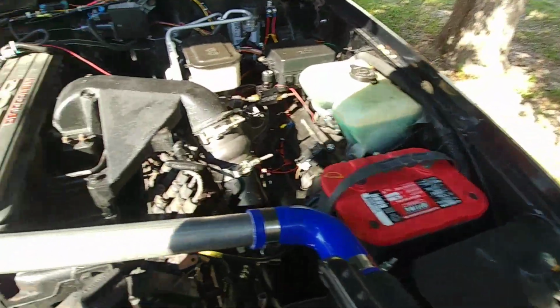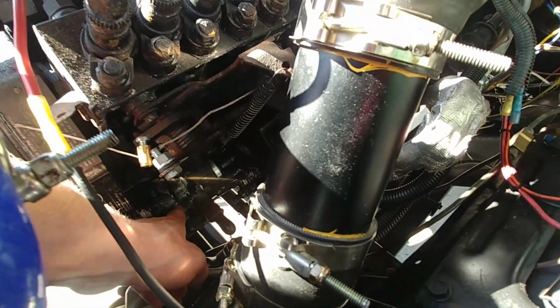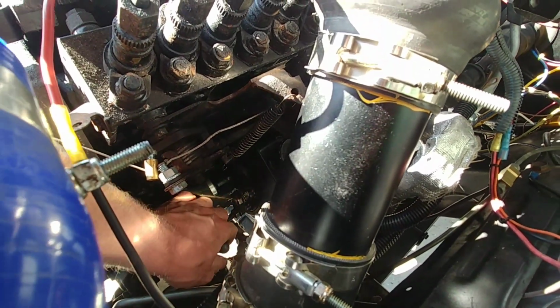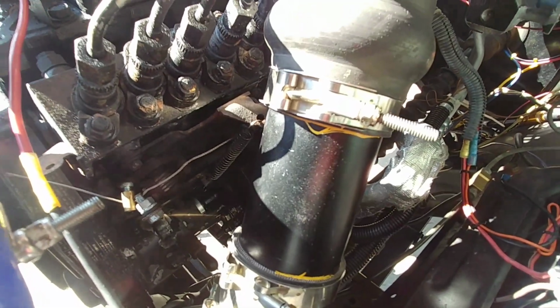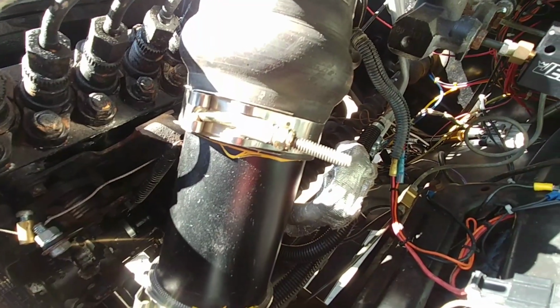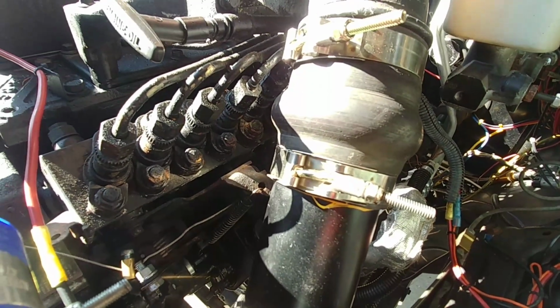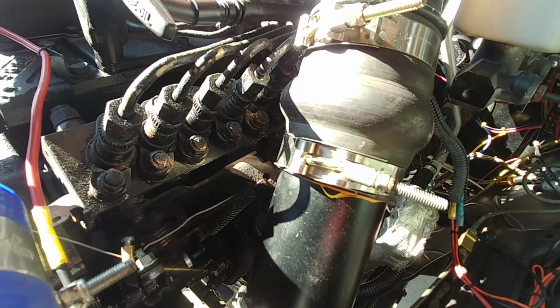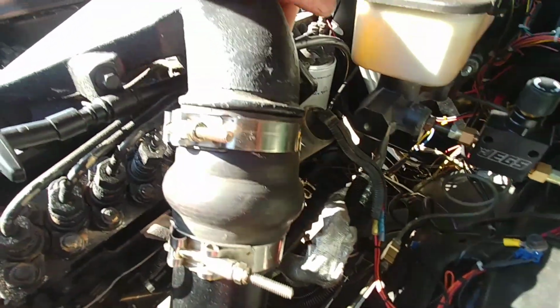As far as making everything fit on this side, if you buy a vacuum brake booster truck, you won't have any problems. If you have Hydro Boost, you need to switch your power steering pump over to the Hydro Boost power steering pump, or you will have lack of braking effort. That was another one of the hurdles of this. Just make sure you buy a 98 Dodge 2500 Cummins. Those came with Hydro Boost, and you can buy the power steering pump for it. This is a 96 engine. It had vacuum brakes on it. So make sure you buy a Hydro Boost pump and put that on, and you'll get your braking effort back.